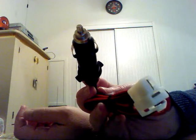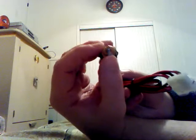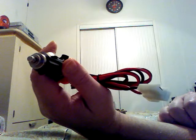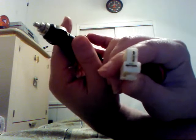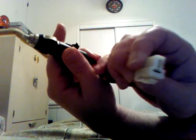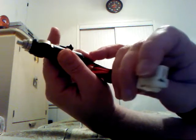This one works excellent, and again, this one just has a single fuse in here. The power plug itself that goes to the radio has another fuse, so it would actually be double fused on that. So the radio would be plenty protected on that. So anyway, this has got 15 amp. It's got the T plug, and make sure your positive and negatives are to the right pins that correspond with your actual radio you're plugging it into. Make sure it's on the proper side.